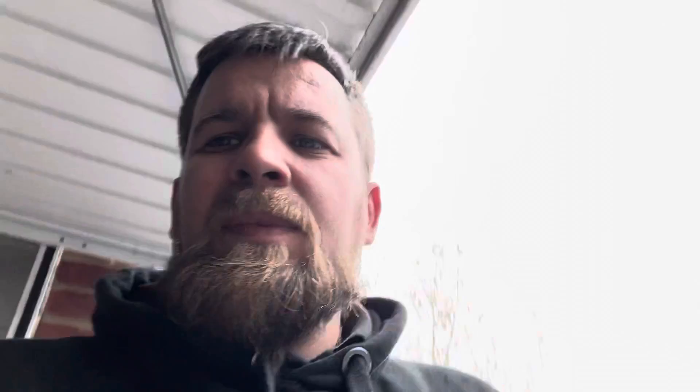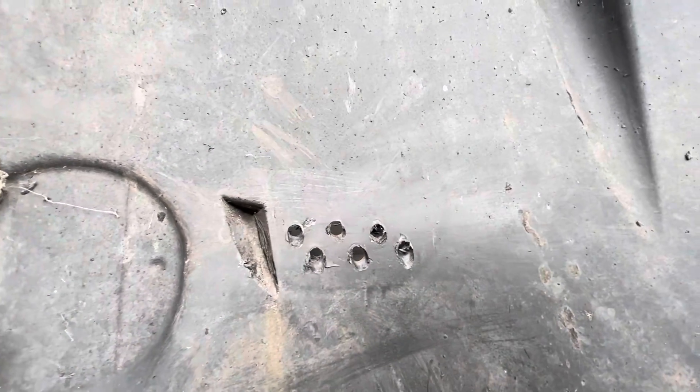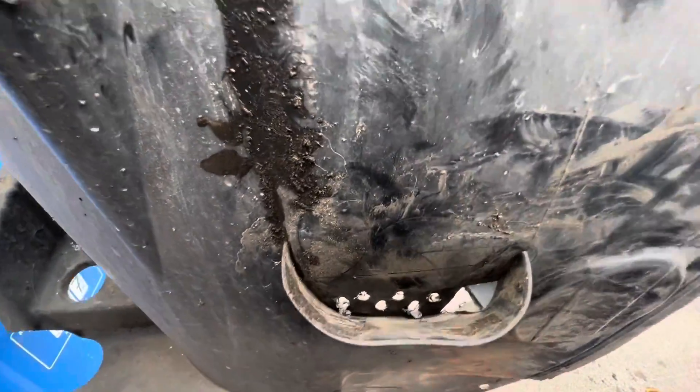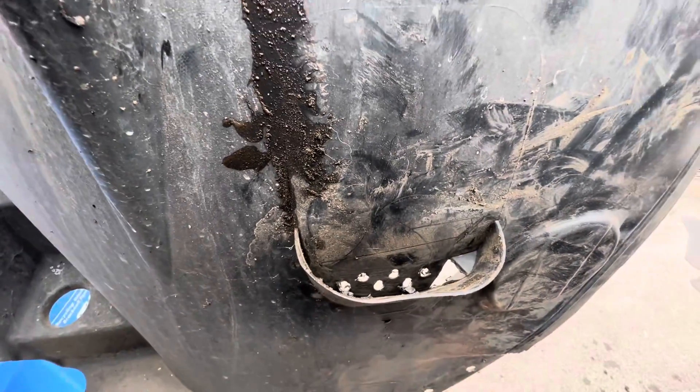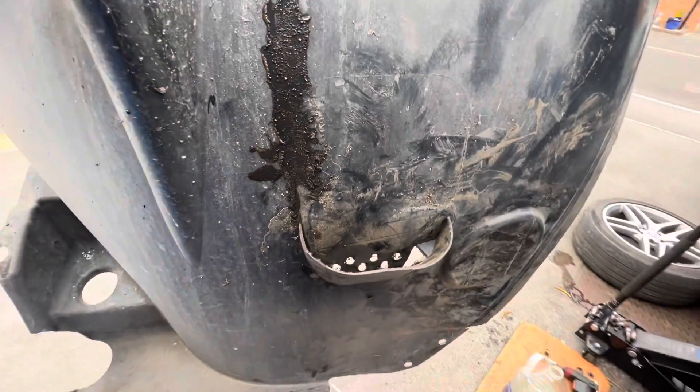I'm going to show you what I've done to modify the drains, to hopefully aid drainage, because that drainage hole in the wheel arch liner is just so small in that catch area. On these wheel arch liners that triangular hole there is the normal drain which gets blocked. I've also added six additional holes — and I'll show you from the other side. As the water collects in here from the tube that comes down from the scuttle, it normally blocks and stops the water going out that triangular hole, so I've drilled these additional six holes to aid drainage. We'll check this on services regularly so we shouldn't get this issue again.